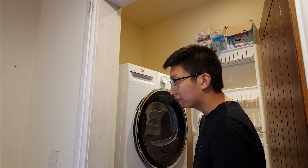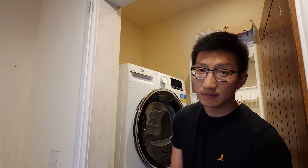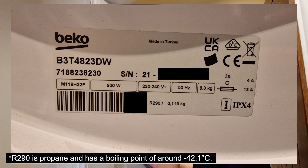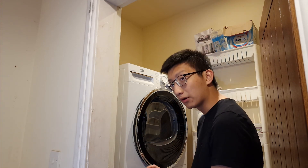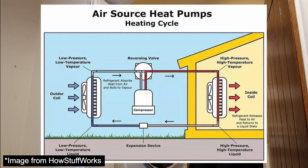In the case of a heat pump, we use a particular fluid called a refrigerant. These are special because their boiling points are significantly lower than ambient — around 20 degrees Celsius. In the evaporator coil, this refrigerant is allowed to evaporate, which takes energy away and puts it into the gas. If you touched the evaporator coil, you'd experience it as a cold coil, because energy from your hand is being transferred into the refrigerant.